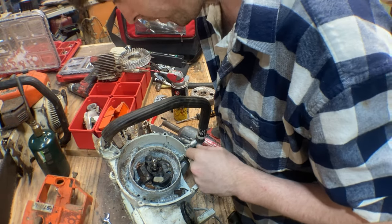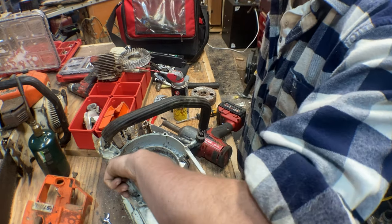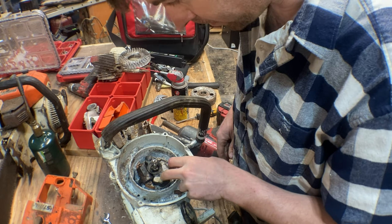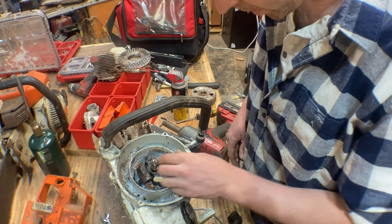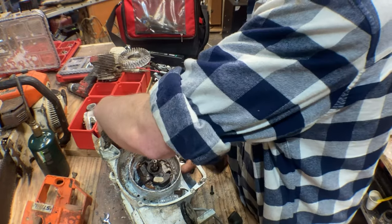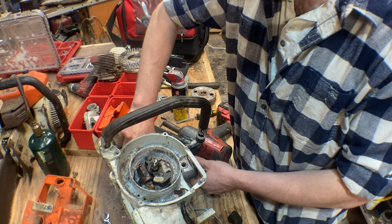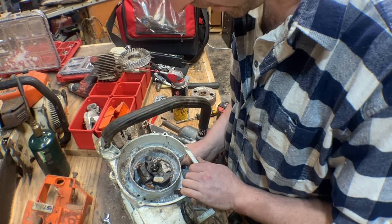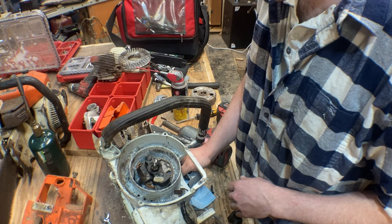There's a special puller for this, however I could see there were some parts detached on the inside, so I figured it's gonna be ruined anyway - might as well use a standard puller I already have. A lot of struggling but it did eventually come apart with a bit of heating. It is a taper, which I kind of expected - but holy crap was it stuck in there, mainly because it was stuck in the side here. I can't touch it right now because it's freaking hot. I might have heated up the case a bit but I was going to replace all this anyway. It rotates - look at that! There we go, rotating at the chain sprocket. It's clutched - I'm happy!